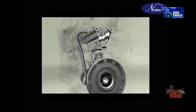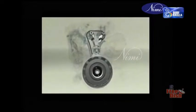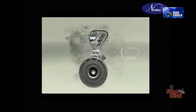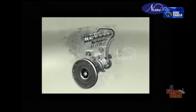A flywheel and its need. A flywheel is needed to drive the crankshaft during the time that the engine is performing the non-power strokes. The flywheel carries the engine over the non-working strokes.